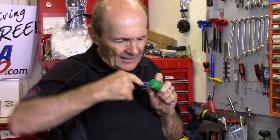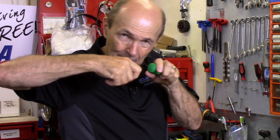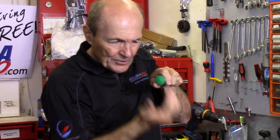Now, some computers aren't like this — some are much easier. If you look on the back, you'll see a slot that looks like a coin slot. You can use a coin, but be careful — they get a lot of computers coming in where people twist a coin and it slips and ruins the slot. There is actually a special tool for that slot. You put it in and unscrew it — it unscrews, falls out, O-ring, battery falls out. So you have the cap, the O-ring on the cap, and the battery. From that point on, rinse and dry, same thing. This is a transmitter, but some computer backs are like this as well.